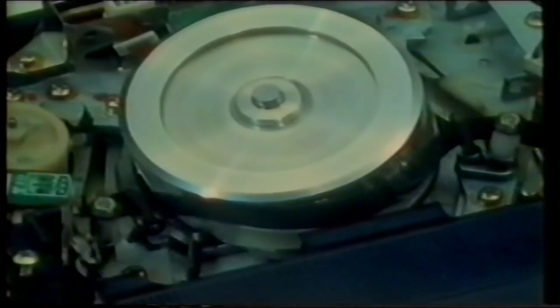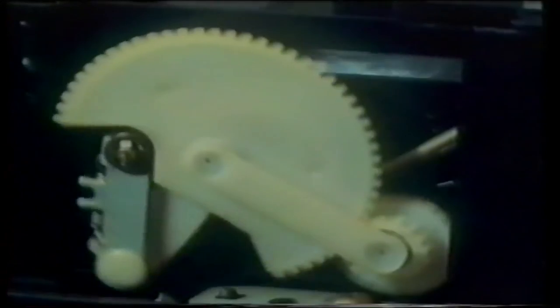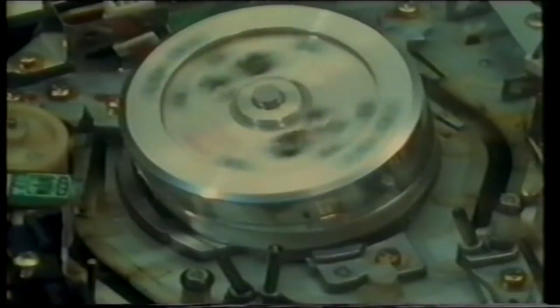The cassette system does add greatly to the mechanical complexity of the machine. Bringing the cassette in and wrapping it round the drum needs two completely separate mechanisms. It's all wonderfully ingenious, but it does look a bit out of place in this age of solid-state technology. A domestic machine only records half as much information about each picture as a broadcast-quality one, but the difference is hardly noticeable. It's only when you record from one tape to another a few times that the electronics have problems and the imperfections start to show up. This is an original recording — the quality's really very good.